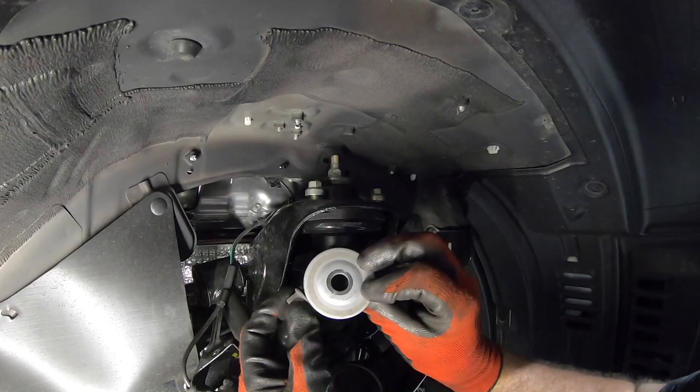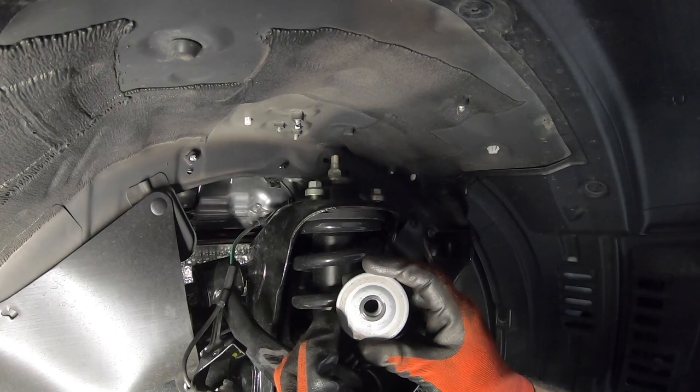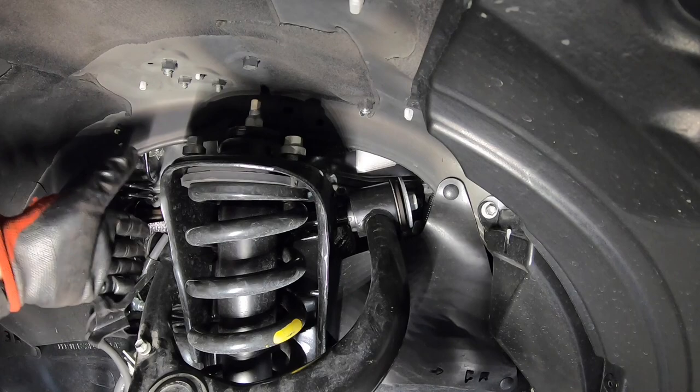See how the washer seats against the bushing on this side and the washer on this side. So you want it to bell out, which may be counterintuitive, but that's how it works. You can see the bushing has already deflected even in a stock application with 2,000 miles and rubbed it. That's why it's offset like that. Set those aside.